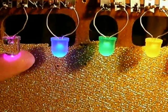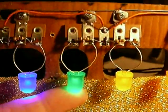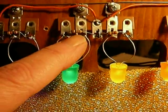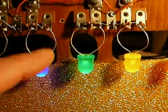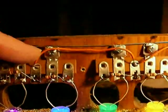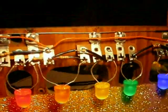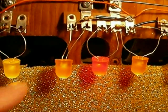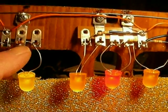The purple, blue, and green are newer InGaN technology and they're more efficient so they take more resistance — they take a 1K resistor for each one. I have a common minus side; this bus bar at the top is a common negative from the power supply, and the positive I have running to various spots on the terminal strips, and then from those terminal strips I have the resistors coming out to each LED. The red, orange, and yellow LEDs take a 330 ohm resistor for each one, so every LED has a resistor.